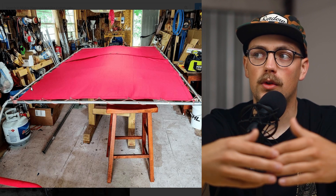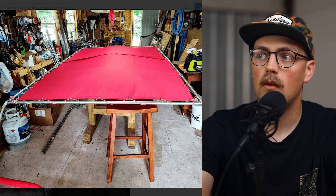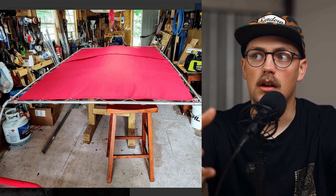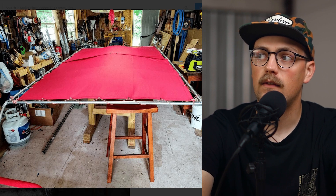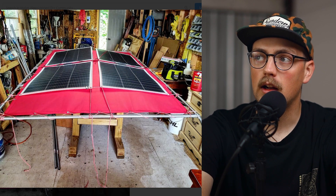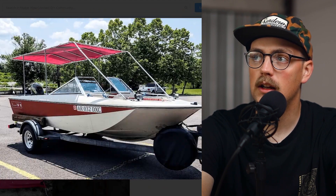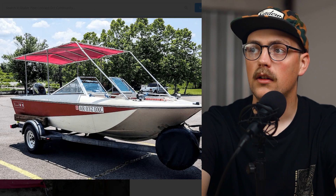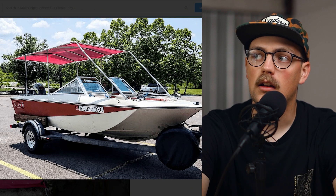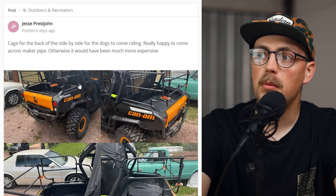He decided to build a frame that's a little bit larger than the sunshade being placed inside it, then use ball bungees — or in this case rope routed through and around the conduit and through the grommets all the way around — to pull it tight and stretch out that fabric. He added flexible solar panels as well, pulled tight to the frame using the same paracord, and it looks pretty rigid. Here it is completed and in place on the boat. He used standard rigid flanges in the back and adjustable flanges in the front. Really great project with great techniques.